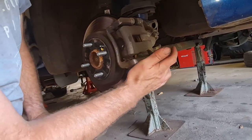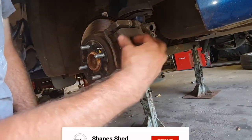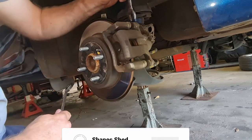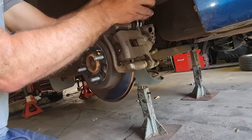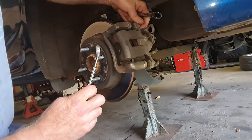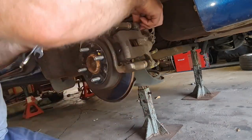These are relatively simple. I just take off the bolts for the caliper slides and just lift this whole thing up and we'll pop the brake pads out. We just need a 17mm spanner and a 14mm. The 14mm is on the outer bolt. The 17mm is just to hold the slide in place to stop it from spinning.